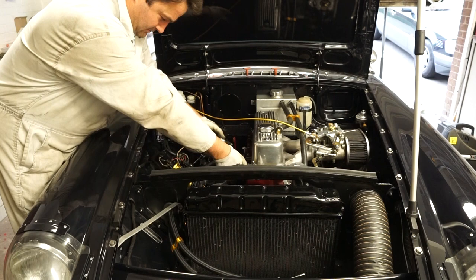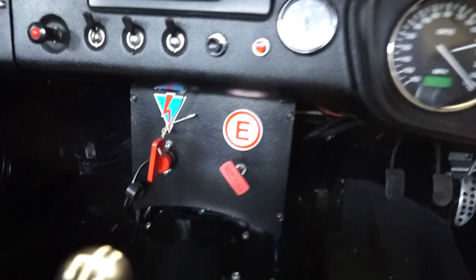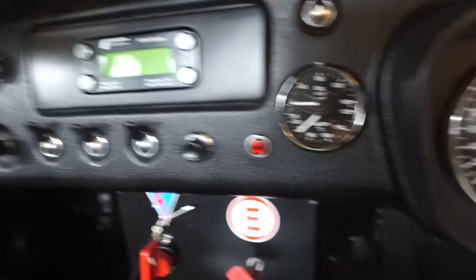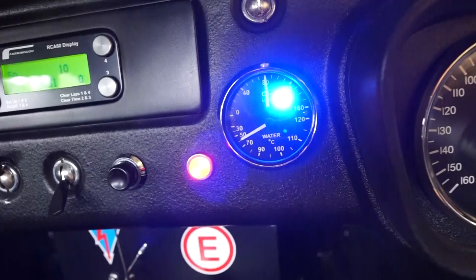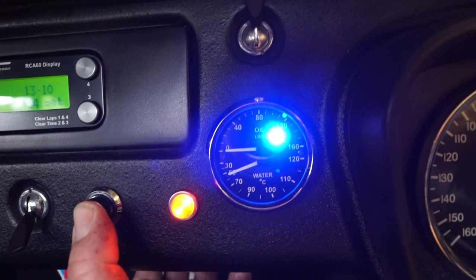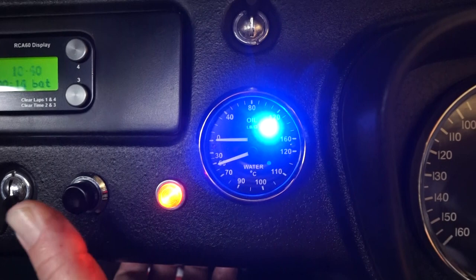So that's the plugs out. I'll disconnect the positive coil as well. So we're inside the car now — hopefully you can see the oil pressure gauge there. I want to just turn the engine over until the oil pressure just shows on the gauge slightly. I'm not actually going to start the engine but I'm just going to put the ignition on. The fuel pump has been disconnected and I have the spark plugs out and the coil disconnected too. You can see it's taking just a little bit of time to get the oil pressure up, so it's always good practice just to make sure.